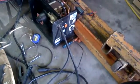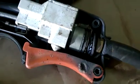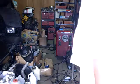Unfortunately, as soon as I started trying to weld it, it gave a little flash and then stopped. I found I didn't have any continuity. I took this wire off as it looked a little corroded, but that wasn't it. I found the problem is in the trigger — all that stuff going black is a poor connection right there. I'm going to try to fix that now. I got the welding trigger wiring fixed, put new washers and a new lock washer on, and it melted down.